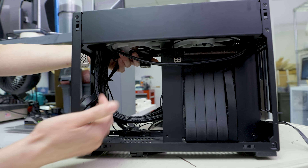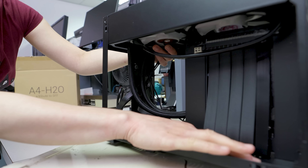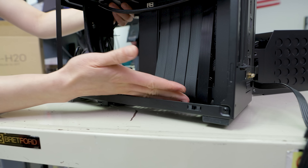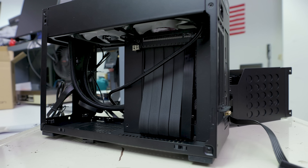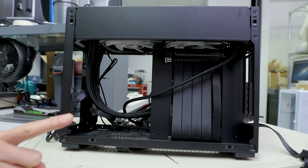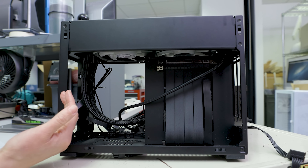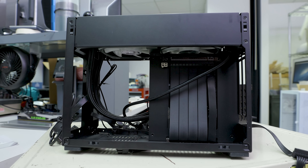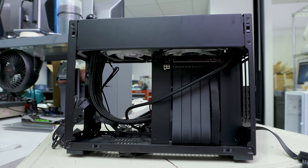Definitely make use of the front cutout in the front panel for maneuvering your graphics card — it is super useful. Also make use of the removable bottom panel, as it helps with power cables and gives you room to maneuver without the riser cable causing difficulty. One more note: this case accommodates triple-slot graphics cards, however, I tried a chunkier card at close to the full maximum length of 322 millimeters — tune in to the completed build section for the full details, because it definitely required some maneuvering.